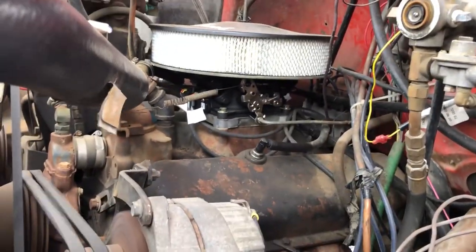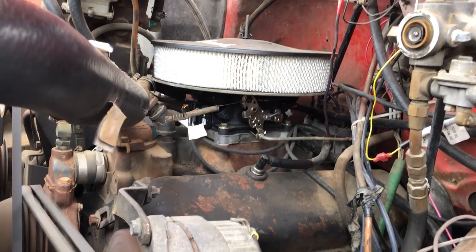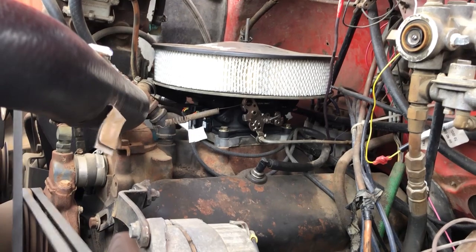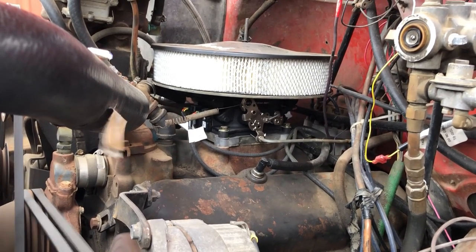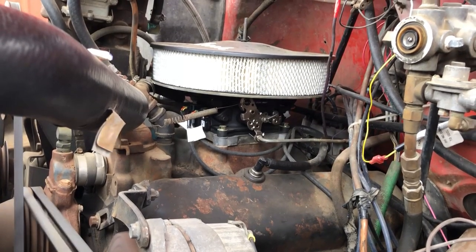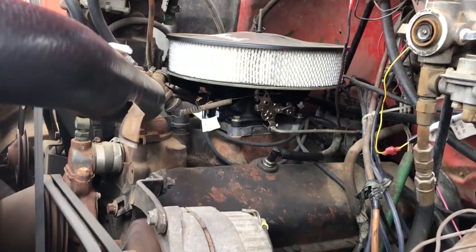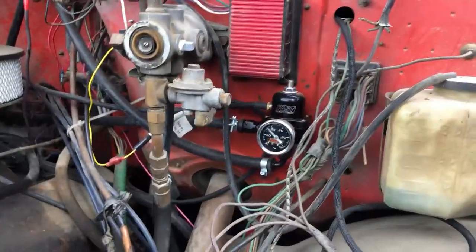That is the EZefi throttle body injection unit. That's a carb replacement. It is wonderful. I have the same system on my Cadillac 500. It's technically 30 over, 507. According to their instructions, that engine is too big. It shouldn't be on it, not power wise, but idle air issues. So I have it on and it runs fine. There is a little bit of a hiccup, but that's all good.